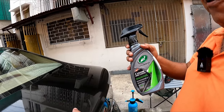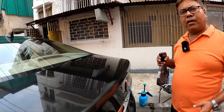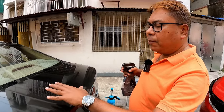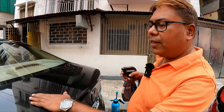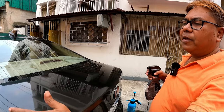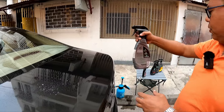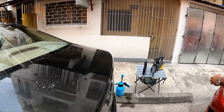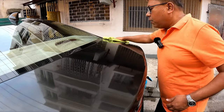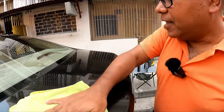After you do the first coat, you need to apply it again after 24 hours to give it long-lasting protection. With a coating applied, it won't stick with water and the gloss layer will stay intact — dust and dirt can be easily wiped off. Use only two sprays per panel, and for applying use a different cloth. Do not over-spray — over-spraying will cause streak formation and will not look good.